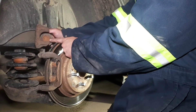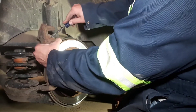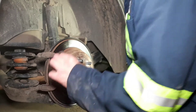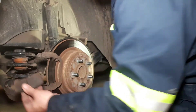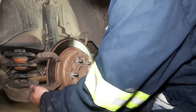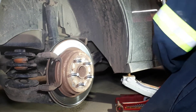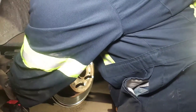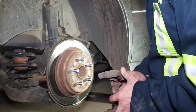This one has also got the shim stuck inside it. One pad out. You can see there's a little bit of life there still, but just the way those shims have gone, it's just old — that's all there is to it. The bolts back here to hold the caliper bracket are 17 millimeter. Caliper bracket comes off.